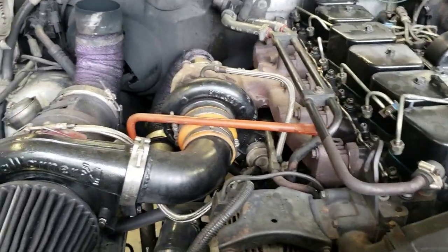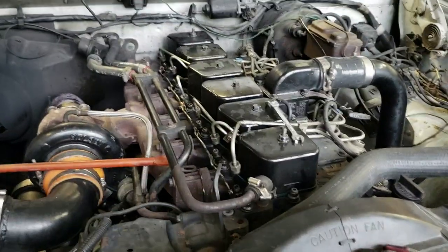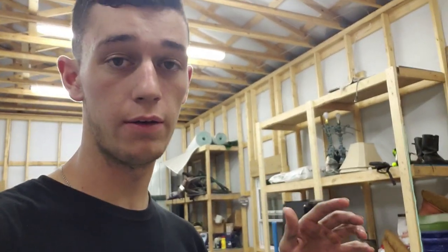My biggest pet peeve is leaks — and I own a 12-valve, so that's not the best combination. But right after doing the injector washers, it actually did make a difference — they're sealing great now. The turbos are getting more fuel and getting happier. I had it at 50 PSI after I did the banjo bolts — it jumped up to 53, and on the way home just now it hit 55. We're slowly seeing better numbers.